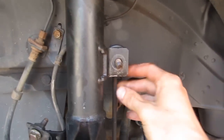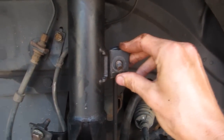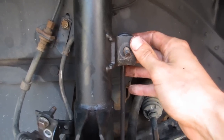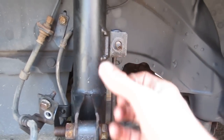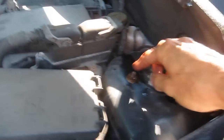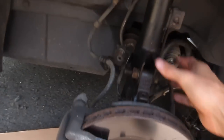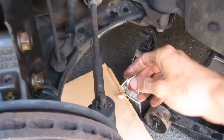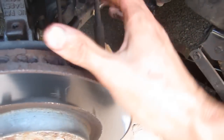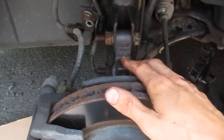I've got to pop this out now, which looks like it's racked a little bit because the car has the weight off it, so I'll try to pop it out gently. I might have to do these bolts first to allow for some wiggle room. That's what you got to do — one, two, three, four: the brake bracket. And then up here you got three bolts which I just oiled down a little bit because they're a little rusted. Hopefully they get out. Once you do that you can take out this whole thing — the spring is not going to pop on you at the moment so you don't have to worry about that. I also forgot to mention I'm going to have to undo the tie rod to allow some wiggle room for the whole brake pad assembly and rotor — I think I can wiggle that knuckle right out of there.